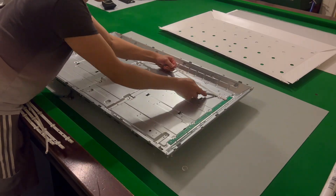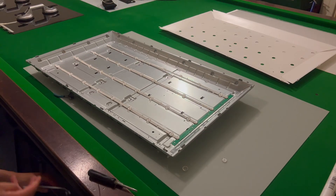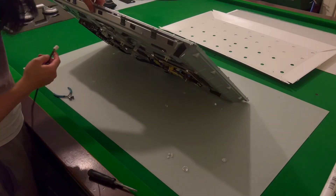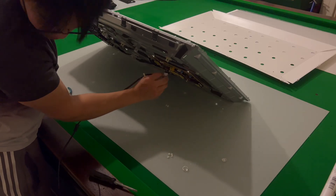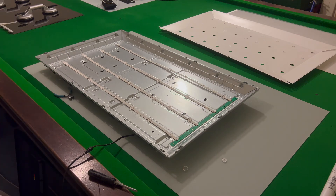I've got my replacement strips laid out along the bottom. I'll put these onto the TV, and we'll also need to replace two lenses that popped off. Before reassembling, I always like to test if the new LEDs are working, so I grab the power cable, plug it into the power supply board, and switch on the TV. This should automatically turn the LEDs on and we can ensure the light coming out is white and the blue tinge is gone — and that's all good.